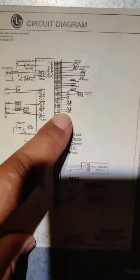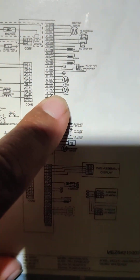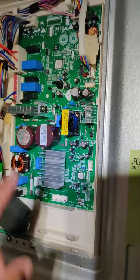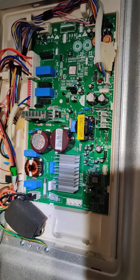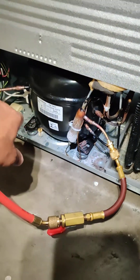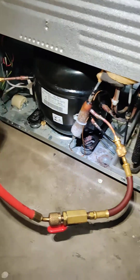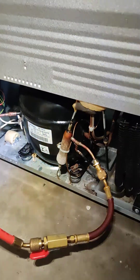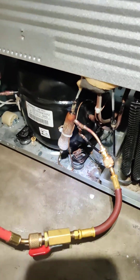The condenser fan is on pins 6, 4, and 2 — that's the pinout. You find that connector on the board, then you will be able to do the whole job. After that you will have to braze and put all that piping and you'll be done. I hope you guys enjoyed the video.